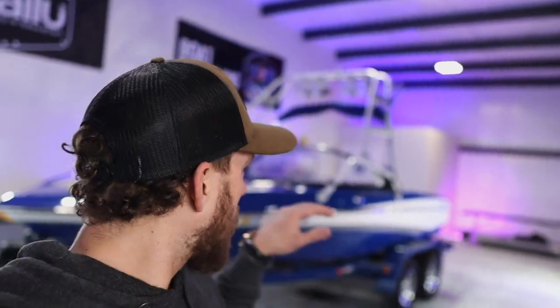All right you guys, that is it for today's video. Thank you so much for sticking around. On this 22-foot boat, we used two white wool pads, two yellow wool pads, and two orange foam pads. We only used about a quarter of the bottle of Wake-Up, and we barely used any of the Punch-It — one bottle will last you many, many times. When it came to the ceramic coating, we only used about half the bottle to do the entire exterior. We only coated the exterior gel coat — we didn't do the glass, the interior, or the metal — and we used about 50 milliliters. The ceramic coating comes in a 100-mil bottle, so if you have a 22-foot boat, one bottle of ceramic will do it.